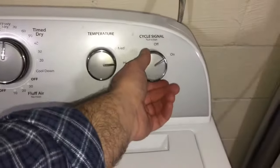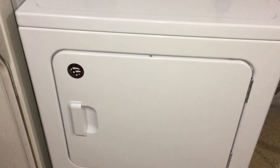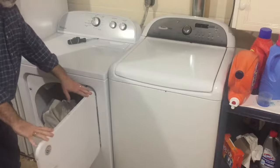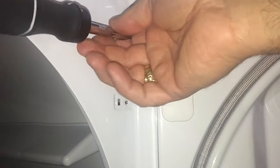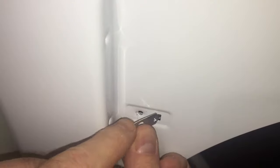Let's give it a test drive — and it works, fantastic. Now I have one final step: I have to change the swing of the dryer door, because right now it opens on the right side, which with the washer on the right side is inconvenient. So I'm going to swap the hinges over to the left. I'm taking off the door latch — one screw, take it out, move it from the left side to the right side and secure it again. There are some blanks on the left side that cover pre-drilled holes in case you want to change the door swing, so I'm going to take those blanks out and pop them in the screw holes on the right side. I'll also move the blank for the screw latch from the right side to the left side — not absolutely required, but it just looks better.